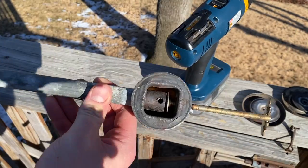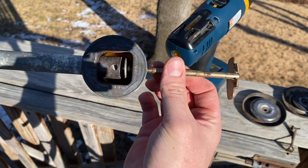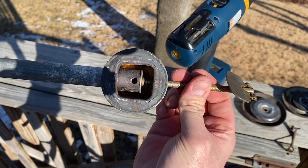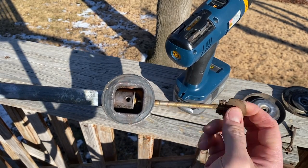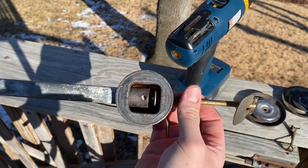Now if you're wondering how the gas works — this is the auxiliary burner. By spinning this, it spins this washer into the tube and locks there, and it doesn't let any more gas get to the actual burner. So if you want a bigger flame, turn it the other way, you can open it all the way up and you'll get the biggest flame that it offers.